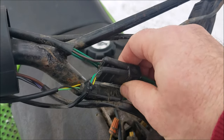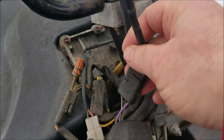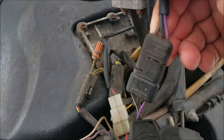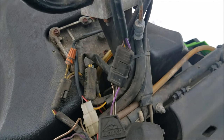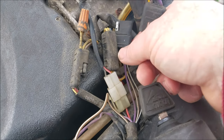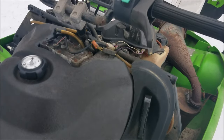If you follow this wire down — it's not any of these, these are mainly for the heated hand warmers — you want to follow this down into the console. On this one there's a purple wire and two black and white ones. Actually there's a black, a brown, and a purple on this end. I'm going to disconnect that. Got that disconnected, and you can test it out to see if this works with it disconnected. We'll go ahead and do that.